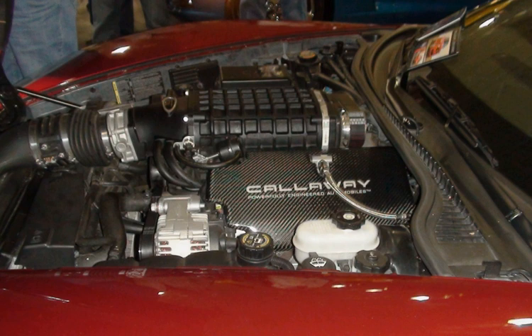The 6.0L is a larger version of the LS motor. 6.0L blocks were cast of iron, designed to bridge the gap between the new small blocks and big blocks in truck applications. There were two versions of this engine: LQ-4 and LQ-9, the latter being more performance-oriented. The Vortec 6000 is a V8 truck engine. Displacement is 5,967 cc (6.0L, 364.1 cu in), from a bore and stroke of 101.6 mm × 92 mm (4.00 in × 3.62 in). 1999 and 2000 model year engines had cast iron heads. It produces 300–345 hp (224–257 kW) and 360–380 lb-ft (488–515 Nm).